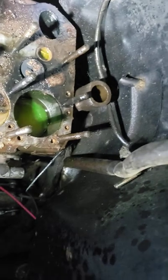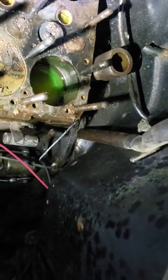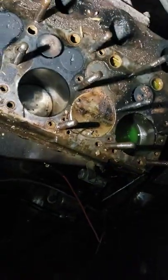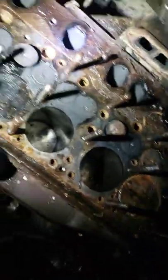That water is probably just from moving around — I didn't drain all the water out of the system, so I've got water in the water jackets and in the cylinder. It was two and six. You can almost see that some cylinders are firing and cleaned off, and then you've got burn over here. Under that water back there is burnt too when I was inspecting it.